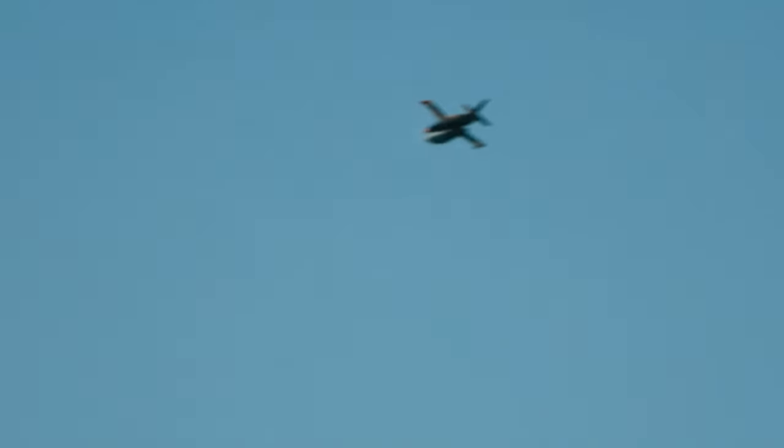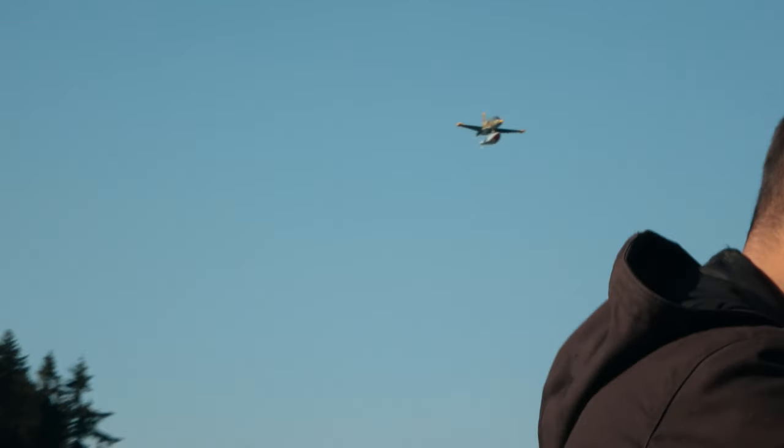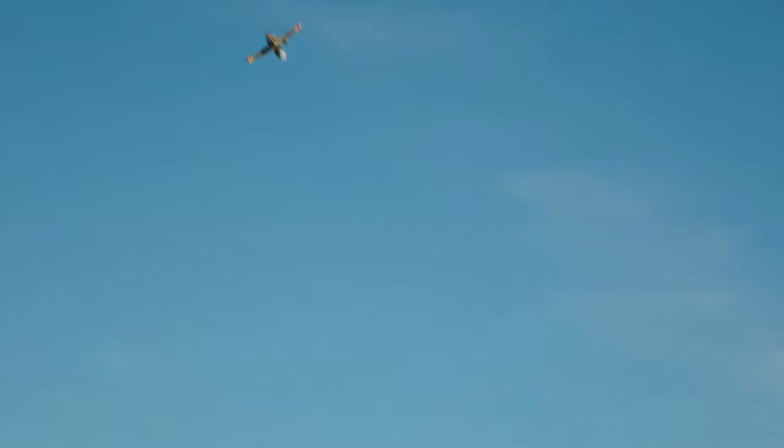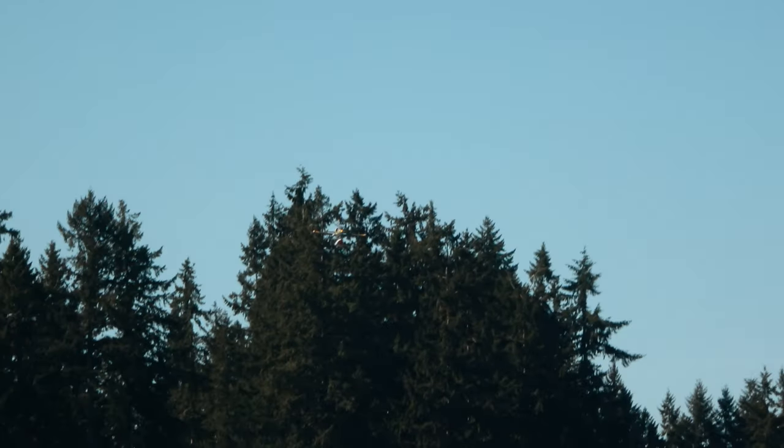Close enough for government work. Despite the ugly takeoff, she was flying, and it was time to get some turns in and learn the plane as safely as I could with the time and space available. As we had guessed, the plane did want to pitch up quite a bit, especially at lower airspeeds and higher angles of attack — hence that violent rotation despite the tiny amount of back pressure I used to rotate. No biggie though, just fly the plane. I trimmed the plane for about 60% power.